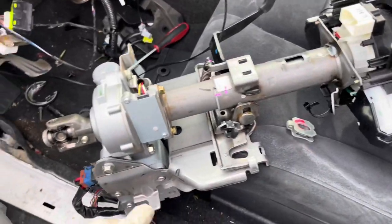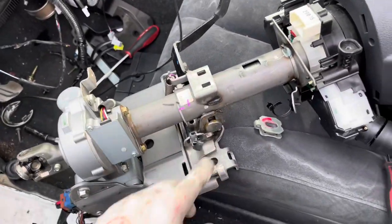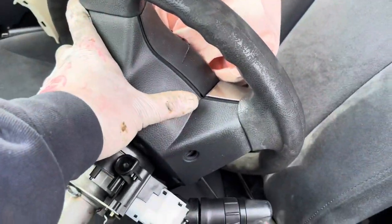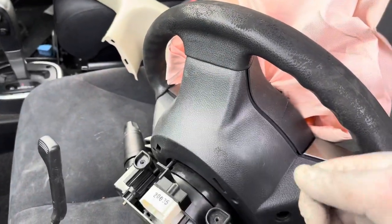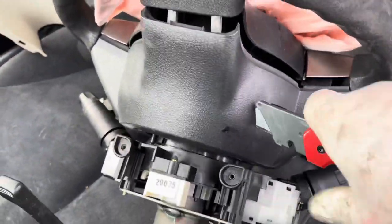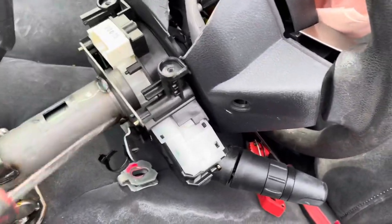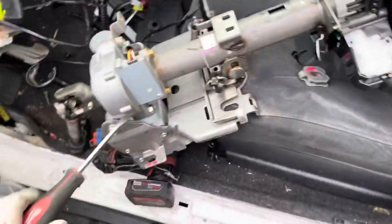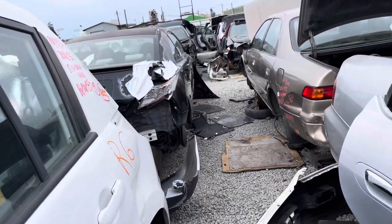In conclusion, it's really just one bolt to undo the u-joint from the rack and pinion, and four 12-millimeter M10 nuts to get the whole column out after you get the panels out. To get the steering wheel off, it's hard to see in there, but all I did was score a line with a knife — it cuts easily. Then take off all the accessories: two screws, a clip at the bottom, and a 19-millimeter nut for the steering wheel — you don't need a puller. I think it's a good idea to take the whole thing as one piece. Anyway, thanks for watching — we're going to be putting that in the Z. Take care!